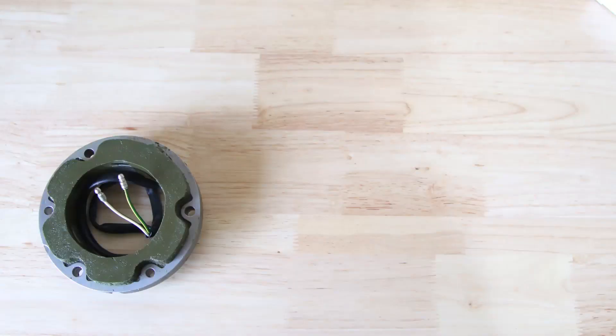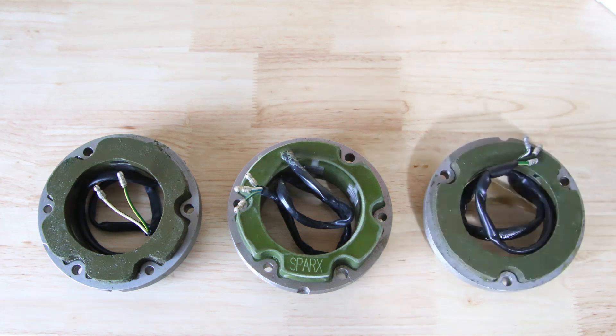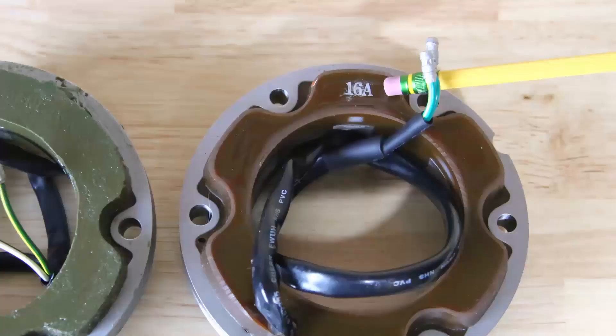Let's talk about options for alternator bikes. As there were and are multiple alternator options available, you'll need to know what yours has fitted before choosing your regulator. You may have a 2-wire single-phase stator, a 3-wire single-phase stator, or a 3-wire 3-phase stator fitted to your bike. If you have a 2-wire stator fitted, you know it's a single-phase, but it may either be a standard 10-amp stator or a high-output 15 or 16-amp stator. To know for sure, you'll want to look for markings on the stator itself. If you can't find any markings, assume it's a high-output just to be safe and select one of our high-output regulator options.